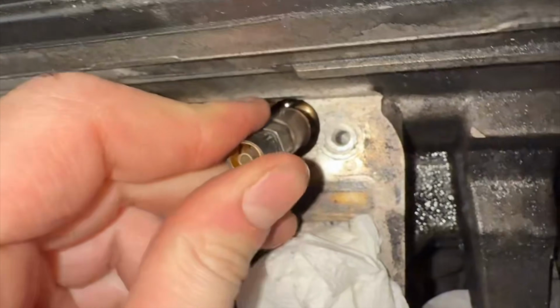The only downside to this is I've been doing this, like actually putting true effort into it, for about a half hour. I got 1 glow plug out. I got 2 glow plugs out. But as for 3 and 4, well, they're suffering the same consequences as cylinder 1 right now, which is the body swelled under heat. So essentially where the threads are, perfectly fine. The closer you come to the base of the head where the compression and the explosions happen, it's swelled.